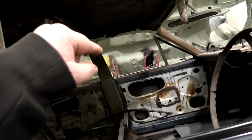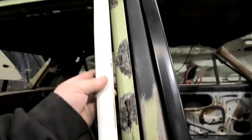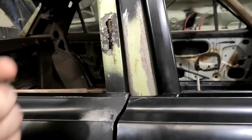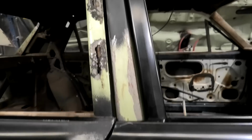So obviously I know I'm going to be putting a passenger front door on. So what I've done is I've hacked the frame off the left front door for the right rear door, because if you flip it around, it's the same piece. It's over here. See? Not just a clever face. Whoopsies. So that's obviously going to be chopped and joined and put in there. I think that's been caused because this was a Fairmont, had chrome on it, and that door was a Falcon 500 door. Clearly, no chrome. So moisture never got trapped behind this one, but it did on this one.